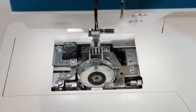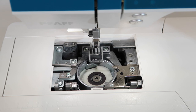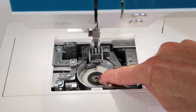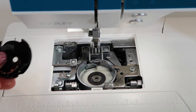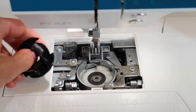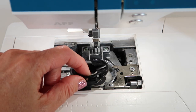I'm going to go ahead and touch my needle up/down button so I can put it back at its exact correct position. Now, about oiling — even though this machine doesn't come with sewing machine oil, I would highly recommend that you purchase some. If you look right down in the middle, there's a little wick — it looks like lint but it's not. You can put a couple drops of oil in there. And note that the big hole in the middle of the bobbin case sits right over this, so you don't even have to take the whole plate off to drop a little oil in — you could do it with just the bobbin out.